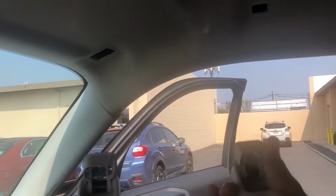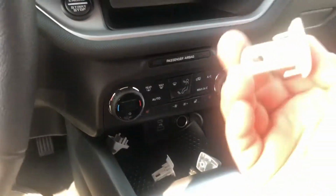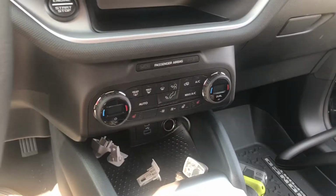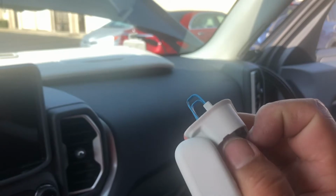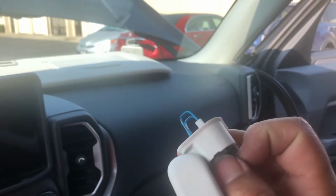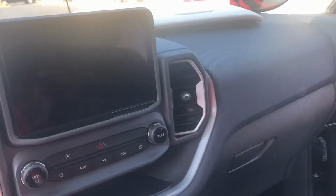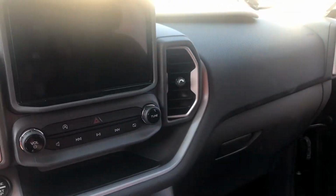Okay, so you guys gonna need to remove all the handles. And then there's this little clip that's inside the handle, and in the handle, see there's this little indent right there where my thumb is pointing. You need to get a pick and push in there and pry it, and this little guy will pop out.